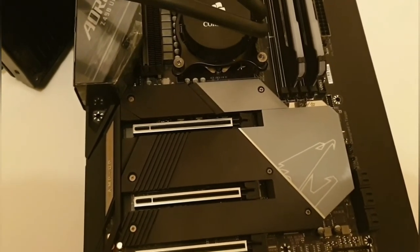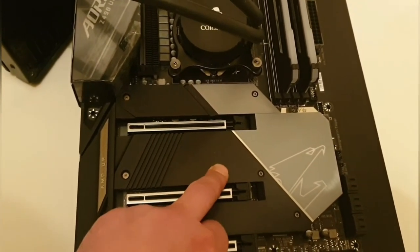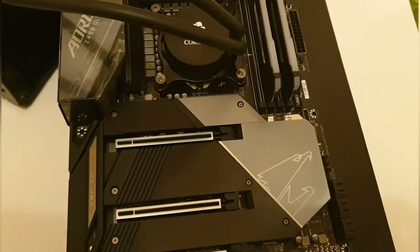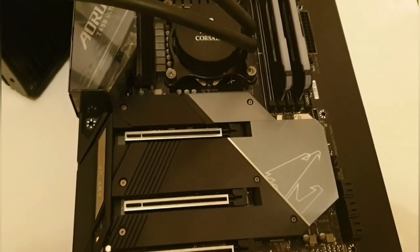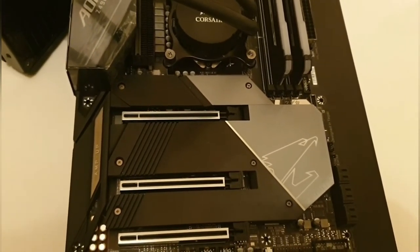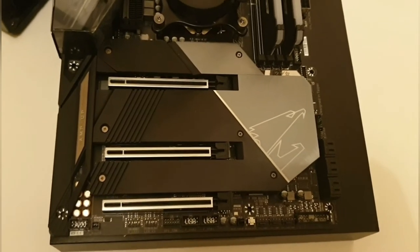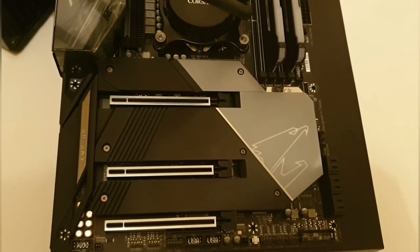Check your motherboard to see if you have a BIOS reset jumper. If you found your BIOS reset jumper, then it should be connected to the first and second pin. If you found the pins but couldn't find the jumper, then possibly you lost it somewhere. For example, if you cleaned the dust with a vacuum or wipes, you can easily lose it. Check the surrounding area, the bin or the vacuum container. This is how the pin should look. My motherboard doesn't have a BIOS reset jumper, so that's why I used a photo to show you.